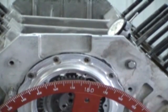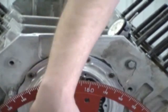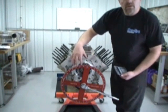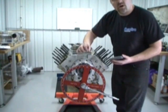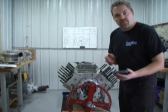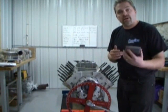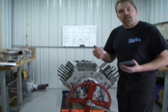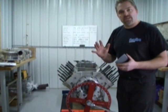If we wanted to make any changes or movements — chains, different positions on the bottom gear — you might have a hex adjust where you turn the button on top, or belt drives are adjustable with the outside ring to the inner ring. Either way, advancing it makes a smaller number for intake centerline. So advanced from here would be 115, 114, 113 — those are advanced numbers. If we wanted to retard the camshaft, your intake centerline number gets bigger. If you have your cam card or you've gotten a camshaft from us, you'll call us up and we'll have it on the card saying you want to degree the camshaft to 110. From here, you would need to advance the camshaft six degrees to make it go to 110, then just repeat the same process.